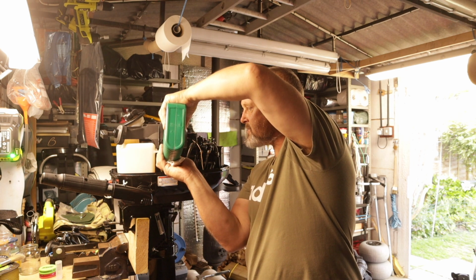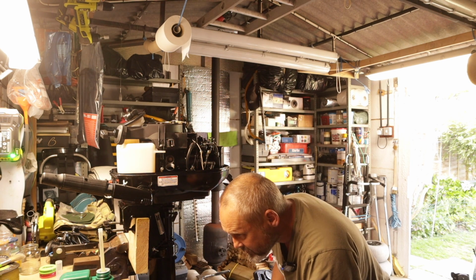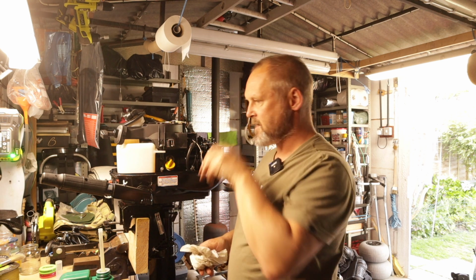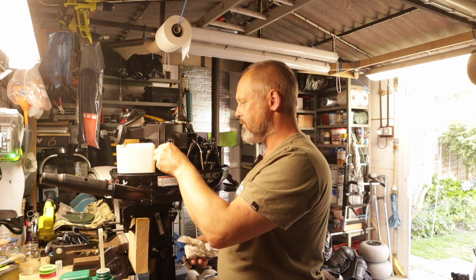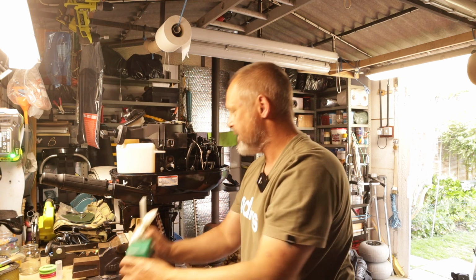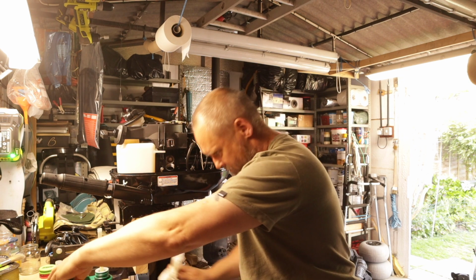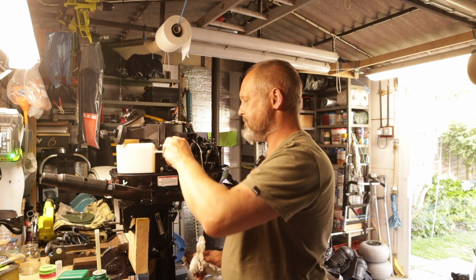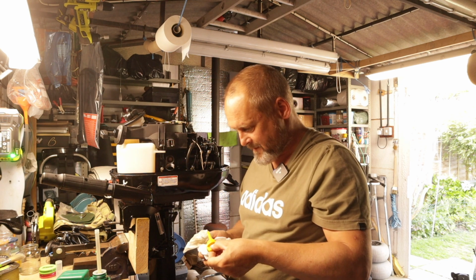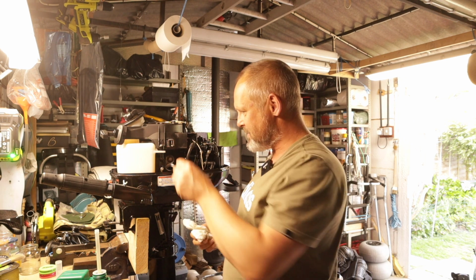We're getting there. I know I'm making this look slow, maybe dragging it out, but I'd rather do it nicely, properly, than have to drain oil out. So I am just above my pen line now. So we must be very close on the dipstick. And we're nearly there. Nearly there. So we're right on my pen line. And we're absolutely spot on. Just under the maximum, at 2 or 3 ml below the maximum.